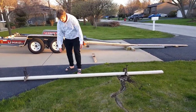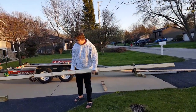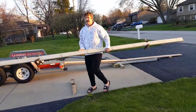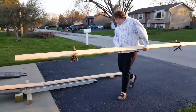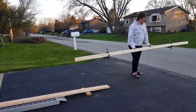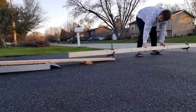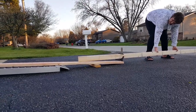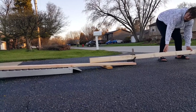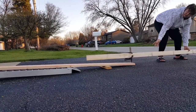The wheelbase is eight feet long, and these little spikes that we clamped to it — yes, it looks as dumb as it is — the spikes show where the wheels go, and that's the exact clearance we have on this car. Each end of the wood simulates the front and rear bumpers of the 240. When you set it on the ground, this is where the bumper is going to be. Up near the front we're really close, but since the tires are round, they're going to hit back here and angle up, which means we're going to clear it.